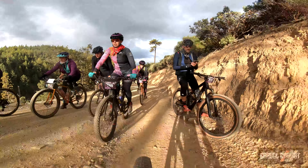That just illustrated the point. If you talk to most road riders today, there's no downside to running a more generous tire — lower pressure, better ride quality, lower rolling resistance. The only thing you bump up against is that over 18 miles an hour, the reduced drag from a narrow tire outweighs the rolling resistance benefit of the big tire. But at the end of the day, is that what people are really going for?